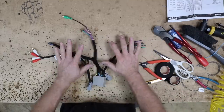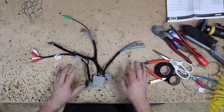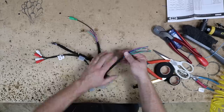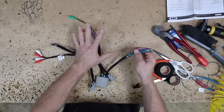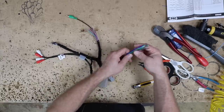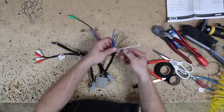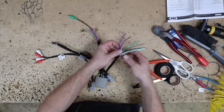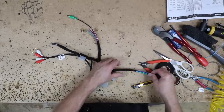So we have our harness all prettied up and organized. What we went ahead and did is take our eight speaker wires and put them all by themselves — they're not part of this harness, because there are a lot of wires in here and this makes it easier. For FYI: white is driver's front, gray is passenger front, green is driver's rear, purple is passenger rear. The black stripe is negative on all of them.